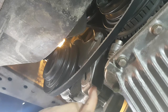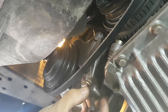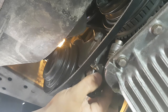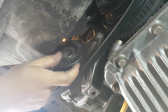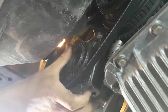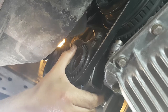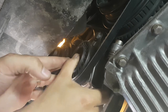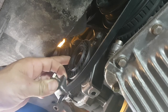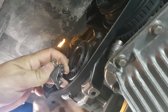Just for the meantime, that's what I'm going to do for my aircon. You can see here where the M6 bolt goes, and this little L-shaped part goes in - you can see how it would work. It slides up and down, and the pulley sits on the outside of that. Bolt goes through. You can see how a 890mm belt would be a lot better than the 875, because even with the 875 it's very close, and this bolt here - which is only 30mm long - isn't long enough.